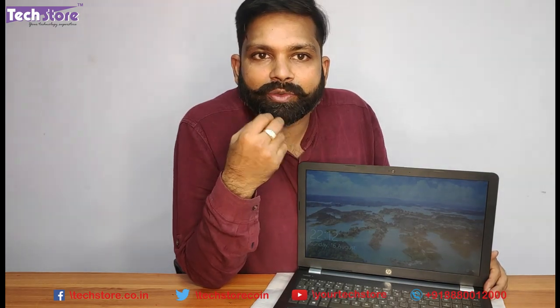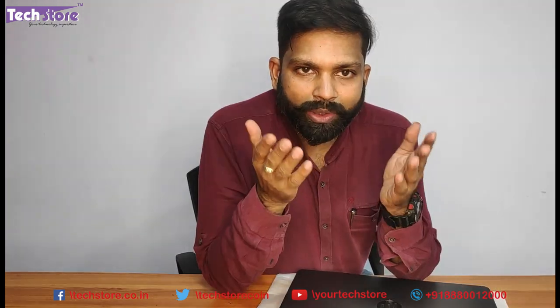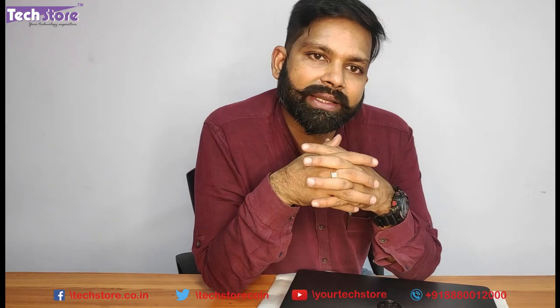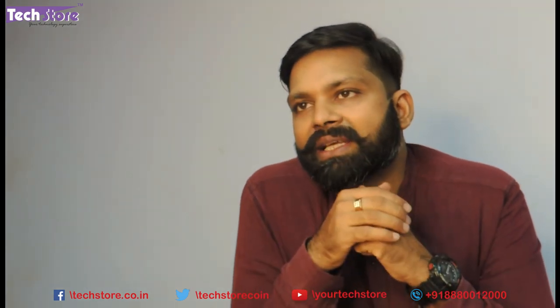Let's power it on. It's powered on now. As you can see, we have Windows booting and the operation is successful. It's a little riskier to do at home, but it's very important that you see this video to understand the complexity involved. The hinges are absolutely fine — with one-hand operation you can open and close. We have successfully replaced the hinges as well as the display frame. After this video, you can replace the display frame, hinges, and the 15.6-inch full HD 30-pin LED screen. This process can be applied to any laptop with this particular issue.